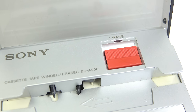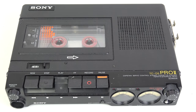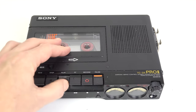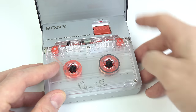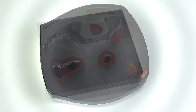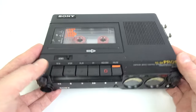As well as being a winder, it's also a tape eraser. I haven't tested this function yet myself, so let's give it a go. On this five-minute cassette I've recorded a message that was being played on the radio — it's announcing a frequency change for a radio station in my area. I've recorded that message onto both sides of the tape. To wipe this tape I'll press down the erase button, which activates the erase head and brings it into contact with the tape. So to wipe it, it's just a matter of putting the cassette in, pushing the button — you'll see the red LED light up next to 'erase' — and now when I close the lid and the tape winds from one reel to the other, that will erase it. Now as I didn't have any instructions for this device I just assumed that doing that would wipe the tape on both sides, but when I put it in my player the message was still there.